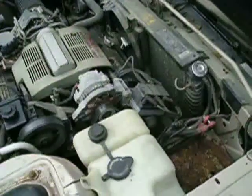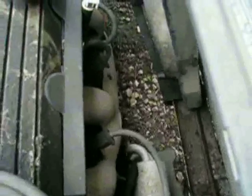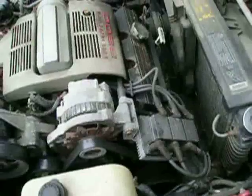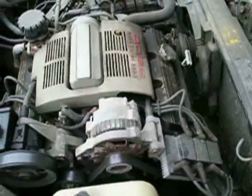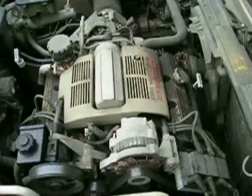There are a couple of basic components in here that most cars have. Here you have the ignition system. This is an electronic spark system, which has three wires going to each bank of spark plugs on the side of the engine. The three front spark plugs are there, and the three back spark plugs are here. They are kind of a trick to get at if you have to change them. If you have some that aren't firing, I would suspect that your electronic module's top half is bad before I'd look at the plugs. But if that doesn't help, definitely check the plugs and see if they're any good. Also check the wires, because they can crack and go bad and result in loss of spark.